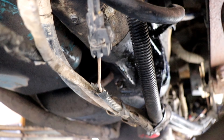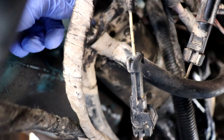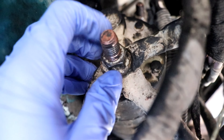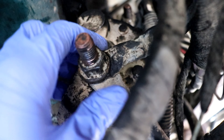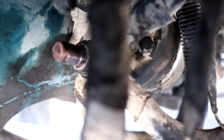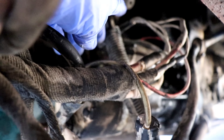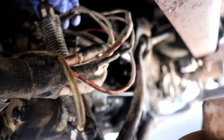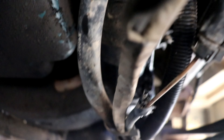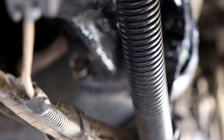So we're underneath the bus and this little machine right here — this is the starter. I've disconnected the batteries, so there's no power going through here. What we need to do is disconnect these guys right here — the power. I believe this is power negative. And then we come up here and disconnect all of these off of this connection. There's a smaller connection on the side, it's hard to reach — a smaller red wire connection that is right here on the backside behind it. This red one. Then we'll come back to the very back where it's being held in place. There are three bolts back here — one, two, three — and those bolts need to be undone.